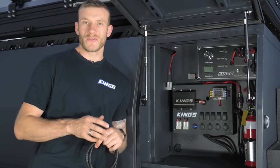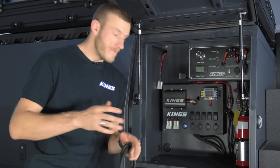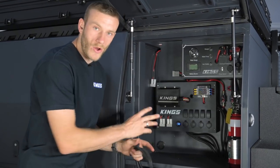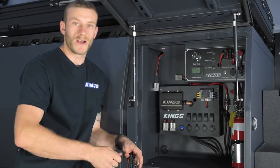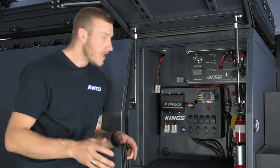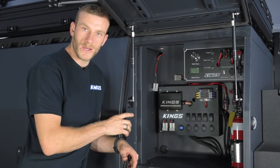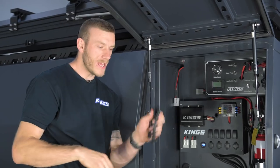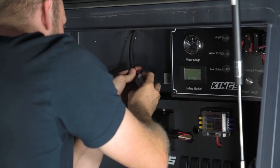The 12-volt Adventure oven would be perfect to plug into a battery box or even a 12-volt control box like we've got here, but we use these two plugs constantly — one wired up to solar on the DC-DC charger and the other one the camera guys are constantly plugging into. So I've asked Khan to wire up this permanent plug here, it's all fused on the inside, so I can just plug it in and we're good to go. Finally, I'm going to add some corrugated tubing to the top part of the wire to stop it from rubbing against the corner.